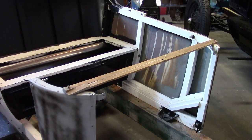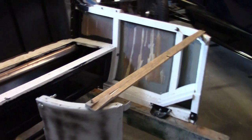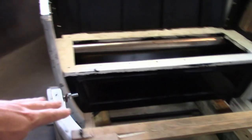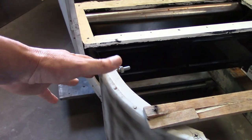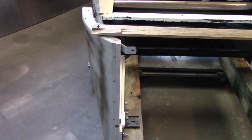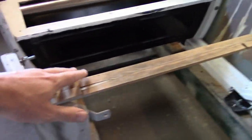Another thing I'll point out, which I figured out a while ago but just never got around to mentioning, is I got this piece of wood between the cowl panels. Now obviously the 1914 and earlier bodies don't have any structure above here, so the only thing that holds this part is the firewall. When you put the door on with the weight of all that, after a while this whole thing starts to twist out, and it was doing that slowly when I was trying to align the doors. So I have this on here to keep it true.